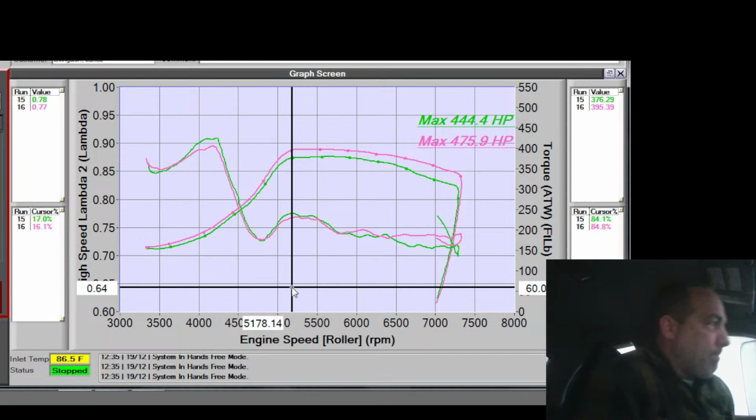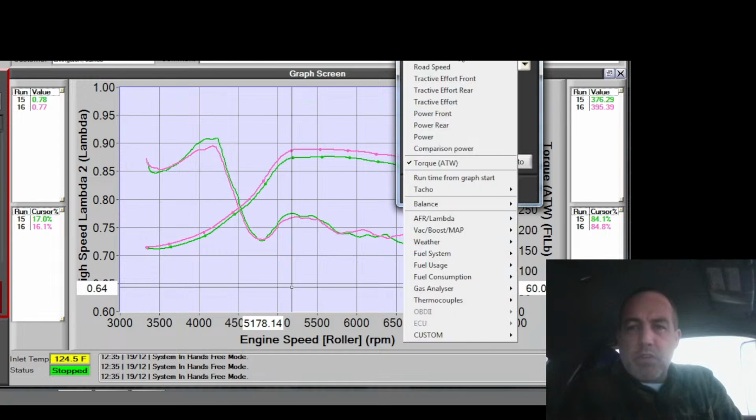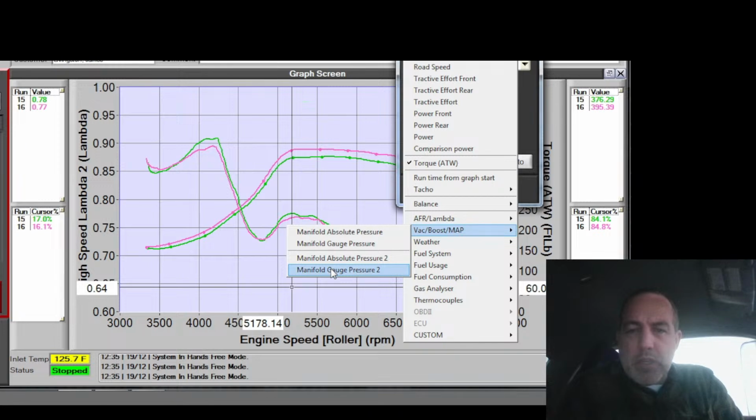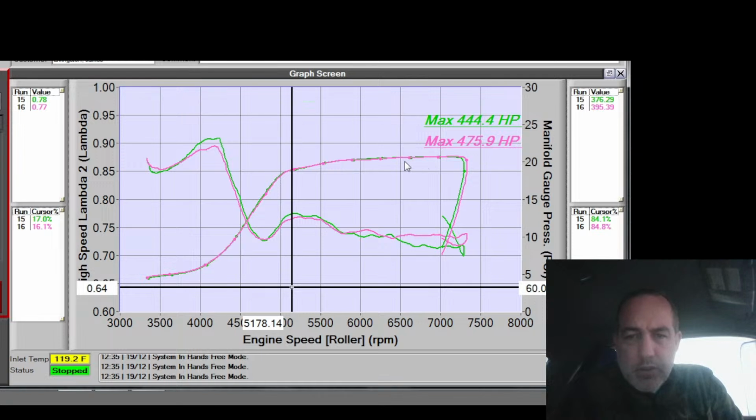Interesting. I mean, we're looking at a reduction in exhaust back pressure as well. And more charge, but the more charge would be seen in the change in the fueling. So, peculiar. How about the boost? Maybe the boost is slightly different in those two pulls too. When you change that cam timing, it's possible that you change the back pressure and change the boost, but this one, no, that is identical.